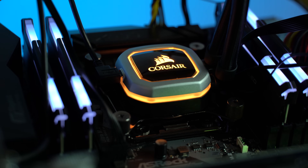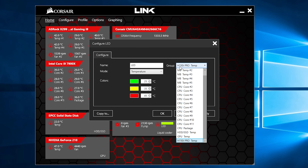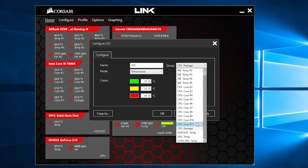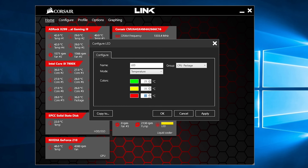You're probably on two sides of the fence. You really like RGB and you can color coordinate that to your build, or you don't like RGB and think it's gimmicky. But if you're one of those people who thinks it's gimmicky, this one has a really cool feature with relation to temperatures. It's got three different levels — you can set the degrees in manually, and also with that you can put a max level. So for instance, if I don't want my cooler getting over 95 degrees on the CPU, I can set that to purple, so if I see my cooler light up purple, then I know something's in trouble and I should stop doing whatever I'm doing.